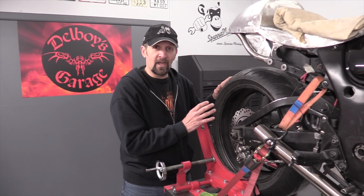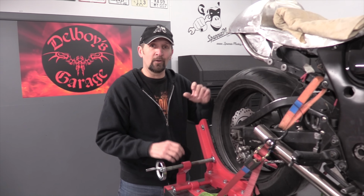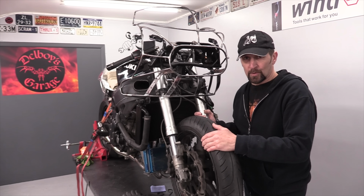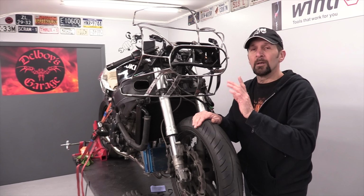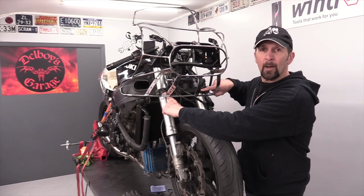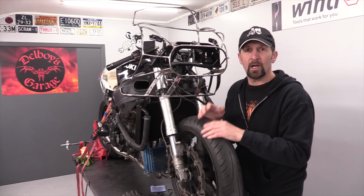Now, if you've done that, and that's absolutely bang on, and you've checked your handlebar clamp, and that's absolutely bang on, the next thing is the forks. Misaligned forks are definitely the most common reason for a bike riding twisted. Not bent forks, misaligned forks, which simply means that the pressure applied to squeeze the fork legs by these pinch bolts in the bottom yoke and top yoke has been overcome by an impact.